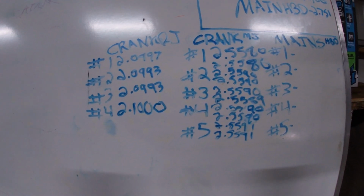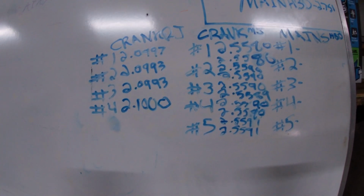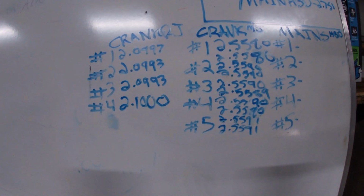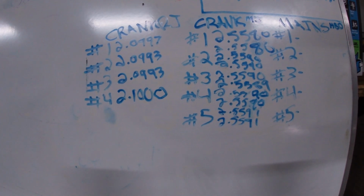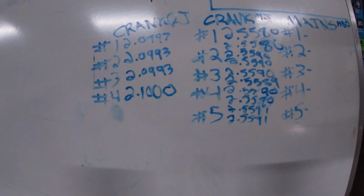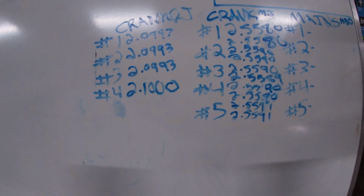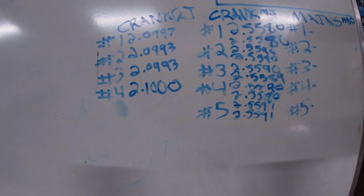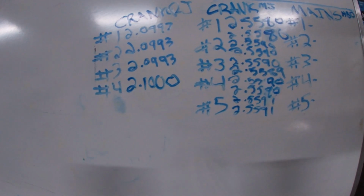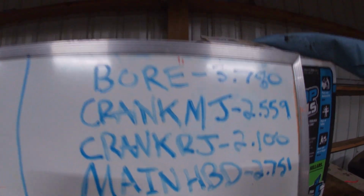All right, guys, so here we have our results. Rod journal number 1, we've got 2.0997. Rod journal 2, we've got 2.0993. Number 3, we've got 2.0993 as well. And then on number 4, we've actually got 2.1000. Now, here is our standard, 2.100.